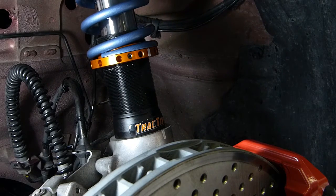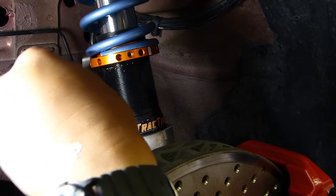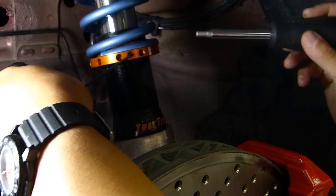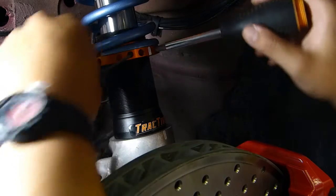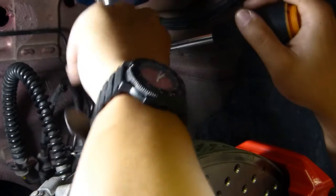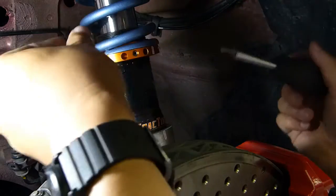That's it — it's a pretty easy setup. There's no need for spanner wrenches. This is a supplement to the first video. Another reason why I keep a spare 2.5mm Allen key is if I want to keep playing with the ride height or for corner balancing — you'll be doing this a number of times. With the additional Allen key, I can keep doing this without having to swap bits, so it just makes it more convenient.